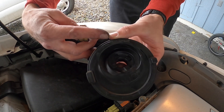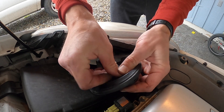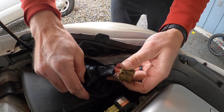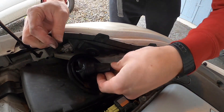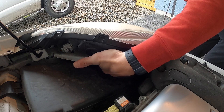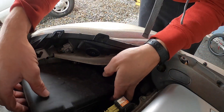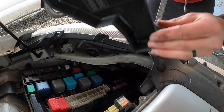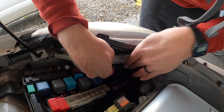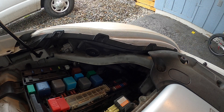The top is marked — open is to the left, lock is to the right. Put the plug through the boot first; that made it a lot easier. Go ahead and plug this into the headlight. Everything about this side is trickier. It's tempting to take this lid off — and yes, taking the lid off does help a little bit. Before putting the boot on, I'm going to test to make sure the headlights are working — two LED headlights.